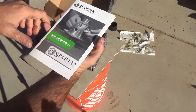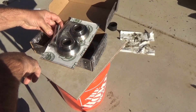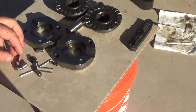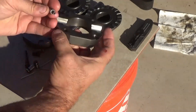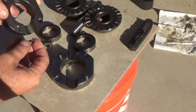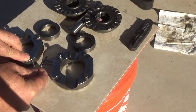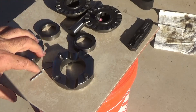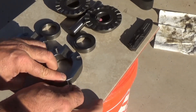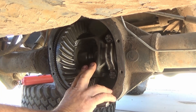So here is the Spartan kit. The kit is very high quality, but honestly my instructions didn't have anything for the 8.8 rear end in it, so it made installation a little bit tricky. What you end up doing is taking the little pins, putting a spring inside each pin, and installing them in the holes — those are the center couplings. Then you push them down with your finger and slide in the small dowel pins to hold those pins down. One thing the kit did not tell me was to cut these pins down so they were very short, which will help with the install.